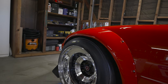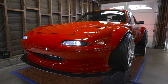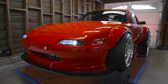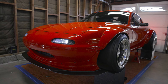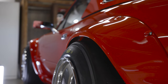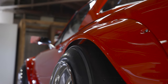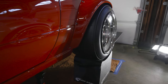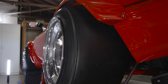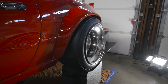The biggest issue with the Miata is finding the right size wheels. Right size wheels makes a big difference because you just don't want to slap on some 15x8s, 15x7s, 16x7s, 16x8s, 9s, 10s — because it's not enough for this car. If you use something that narrow you're going to need to space it out, and from the back your rubber is going to look super tiny because you've just spaced out some really narrow wheels. The best thing to do is find yourself some wide wheels.